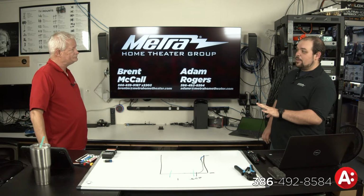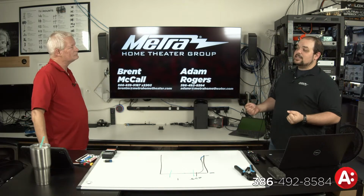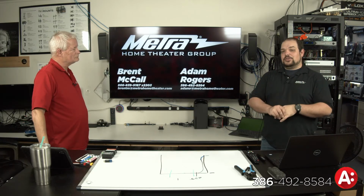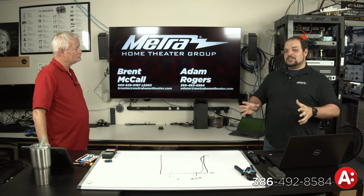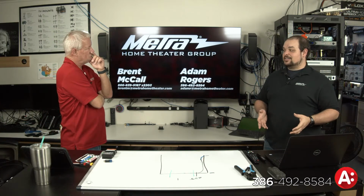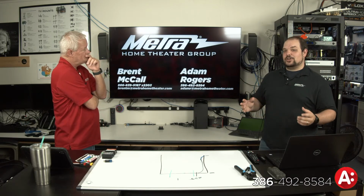Does it always happen when you first turn it on, or when you change inputs, or does it happen while you are watching the video? These are very important things to know, because just because the cable box goes out doesn't necessarily mean that there's a problem with the cable box. We may have a problem with something else if it happens when you first turn it on.